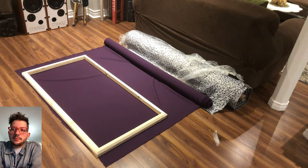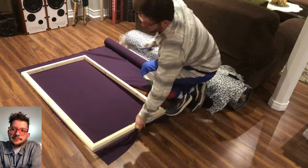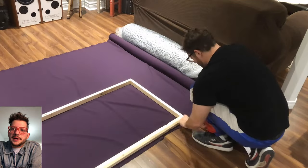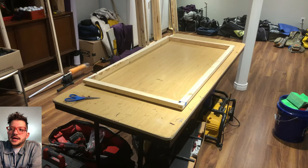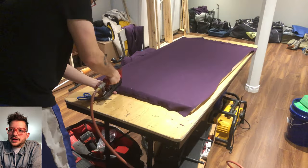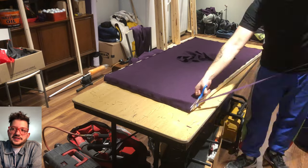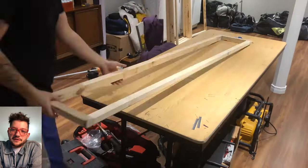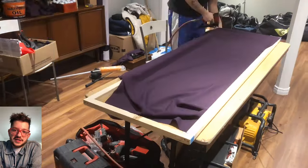Here I'm cutting out the rear upholstery first. I'm using purple because that's what was available at my supplier at a good price, but usually we would use black or whatever is on hand for the rear. This is just a poly-cotton blend and we are stapling each four corners before getting each length stapled on. Just light tension here to make sure there are no wrinkles and the fabric lays nice and flat, then we trim off the excess. We get all of the rear upholstery done first so we have something to catch our acoustic insulation.